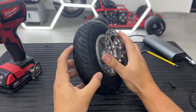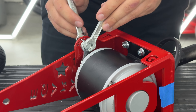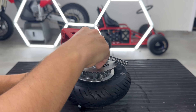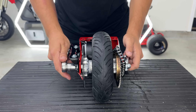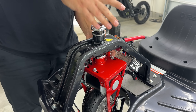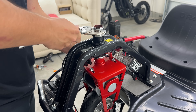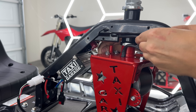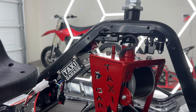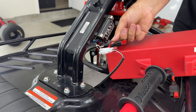Look at this upgraded wheel — the rotor, the tire, the sprocket, everything's upgraded. Now we work on the stem: install the chain tensioner in the third hole down, making sure it's not too tight, then install our upgraded chain — next to the stock chain you can see it's a huge upgrade. The wheel goes in with two spacers, washers, and the bolt goes right through. Tighten it evenly from both sides and put the chain on. Make sure everything looks good before throwing the bottom bearing on — balls up — and install the fork. Use the special tool to tighten the two nuts: tighten the top nut then loosen the bottom one a little bit so you've got a sturdy but turnable fork. Feed the motor wires through the cart with just the right amount of slack and zip tie it. Using the included Anderson kit, turn these motor wires into a plug that snaps right into the controller.